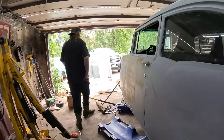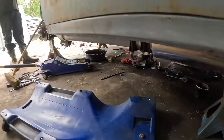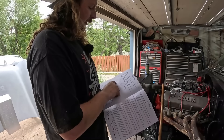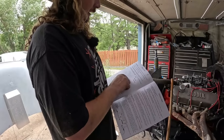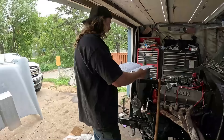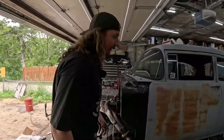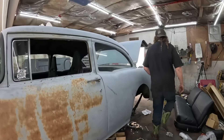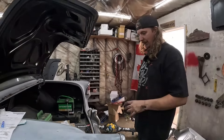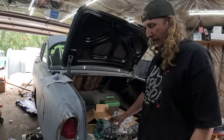We got the unit in there. Pretty simple — we're over here. We're going to have to crawl in there. So the tail housing kind of goes on, then you just want to make sure you shim the little coupler. It has to be under 20 thousandths. We probably had about 10 or so just the way it worked out without any shims.